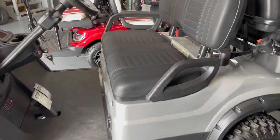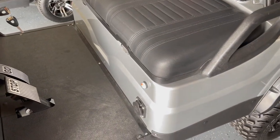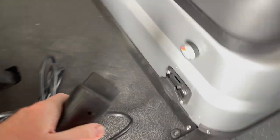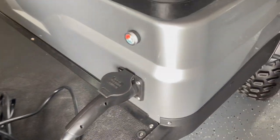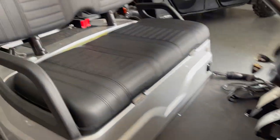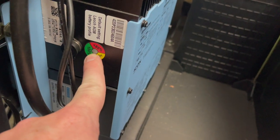I already explained these are AGM batteries. What's really nice about Icon is they have a built-in on-board charger, so you don't need a big clunky external charger to carry around — it's eliminated. You'll just have this cord that plugs into a standard 110-volt outlet. When you plug it in it'll flash, then turn red indicating it's charging, then yellow, then green when fully charged. If it's bright outside and hard to tell yellow from green, just check the dash — it'll be very clear when it turns green.